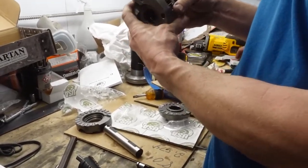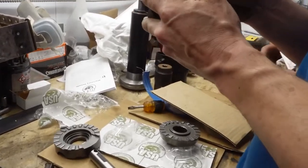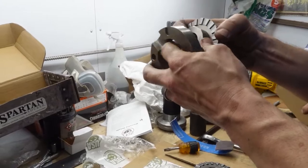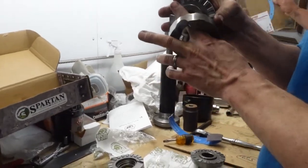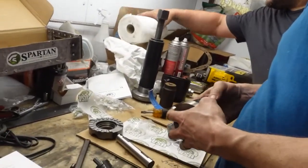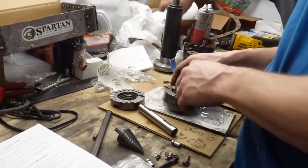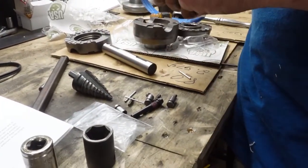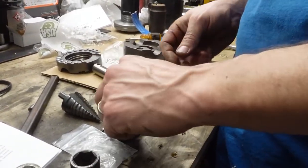Your C-clip goes in through right here. So when it goes in, it goes onto the axle. You slide that over it and that locks it in, then the cross pin won't let that come off, so that holds the C-clip in. They're pretty neat the way they work, really. And then all those little parts. All it does is these springs go in here on each one.